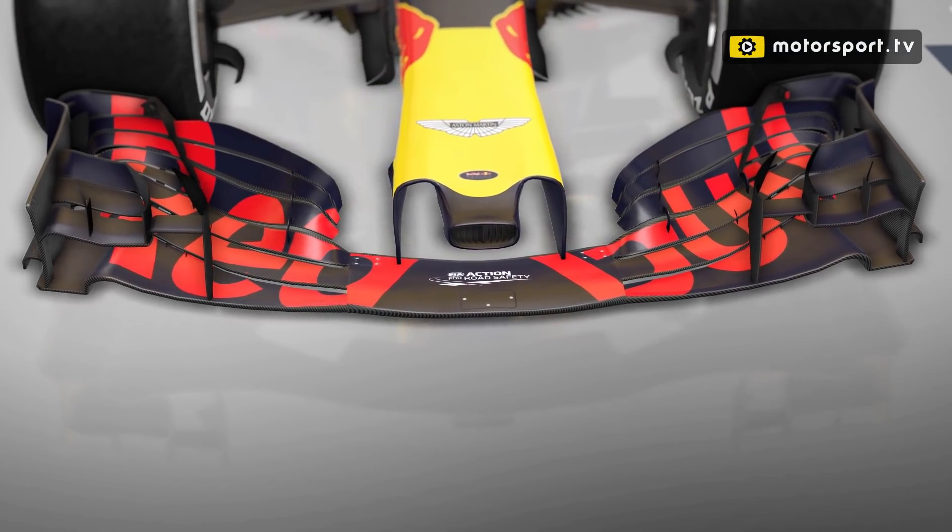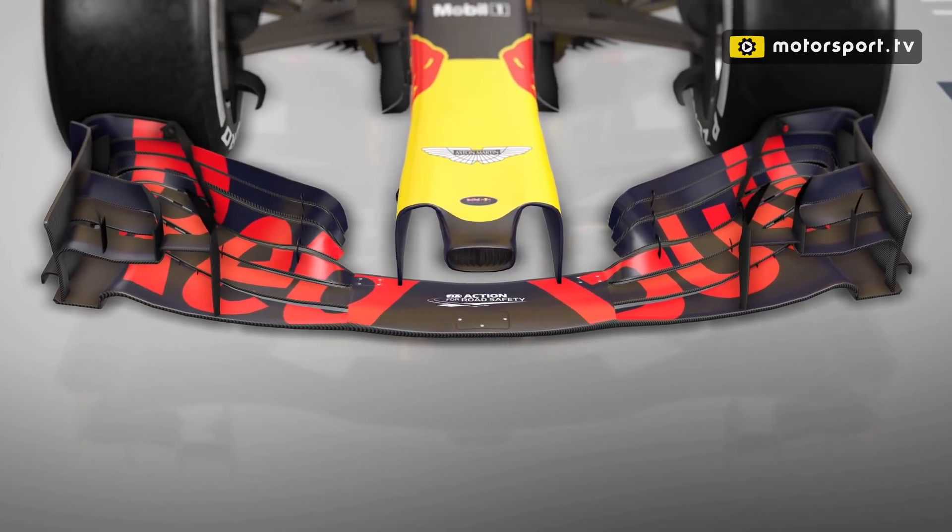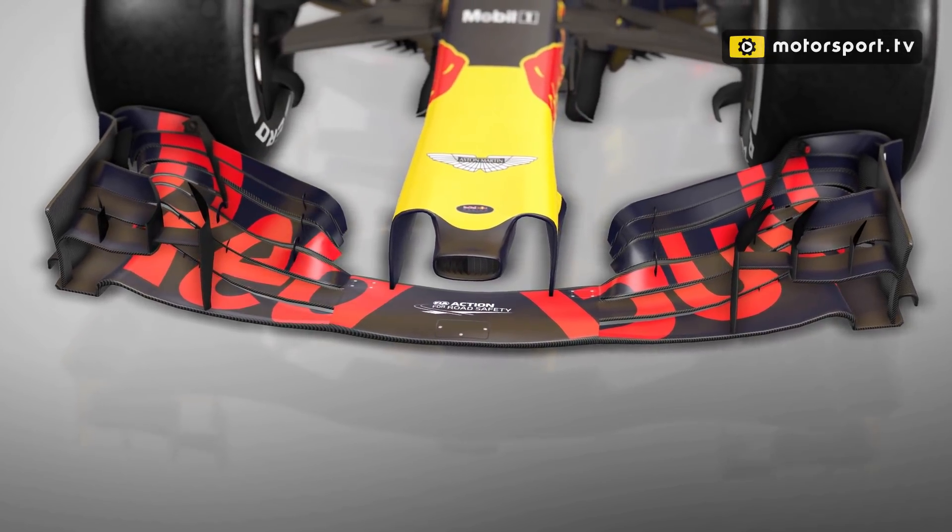So why do we try to understand that? First of all, let's go back and think exactly what the front wing is doing. The front wing is really only there to create downforce to balance that at the rear. So when the teams are setting the car up, they think about the top speed they need — that gives them their rear wing level because it sets the drag for the car. So the flaps are only there to react to what's being created at the rear.